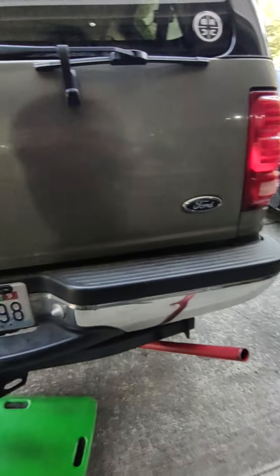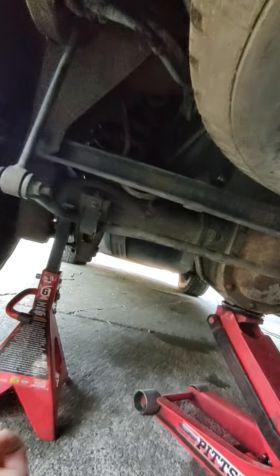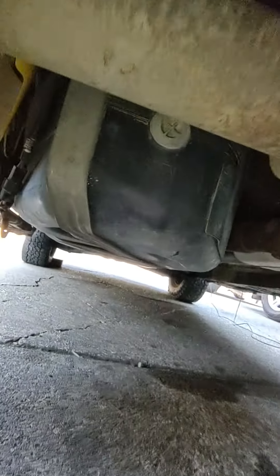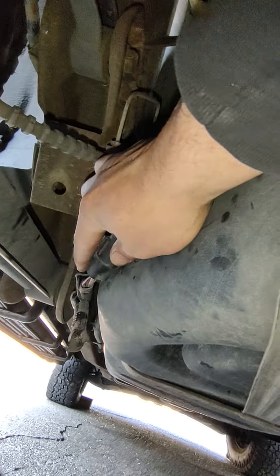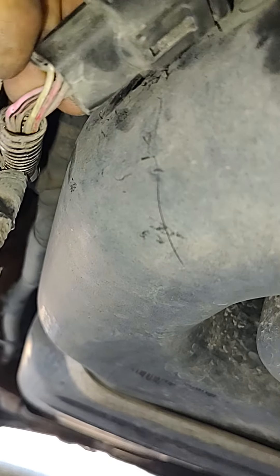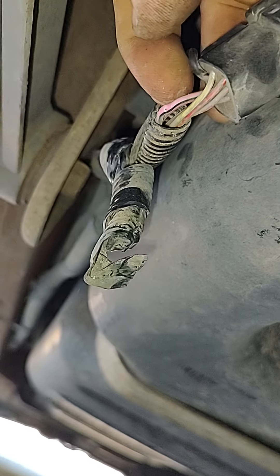If you really want to re-verify that the wiring from the switch all the way to the back is good, you can come over here and locate the fuel pump harness connector and locate the power wire coming out of the inertia switch. I already checked for power there — there is power coming out of the inertia switch. So I know all my wiring is good, my switch is good, my relay is good, and my fuse is good.